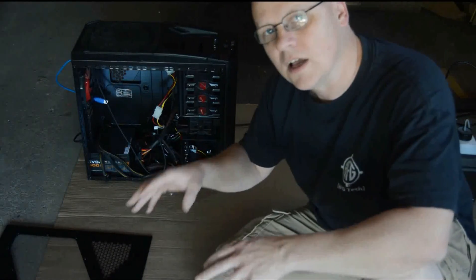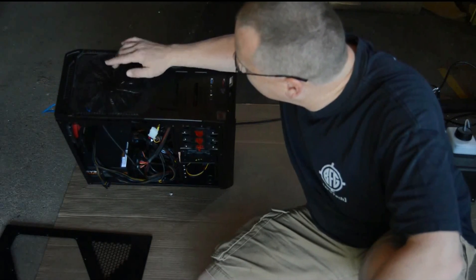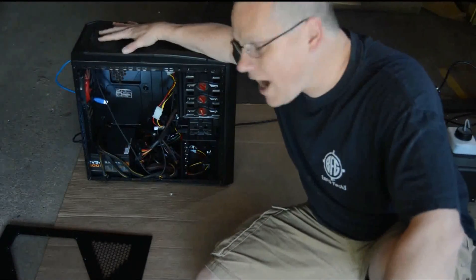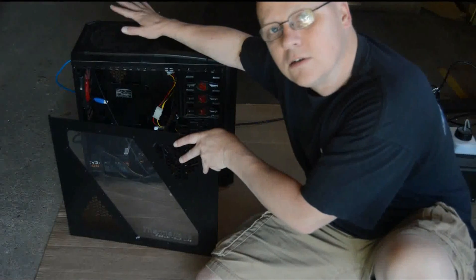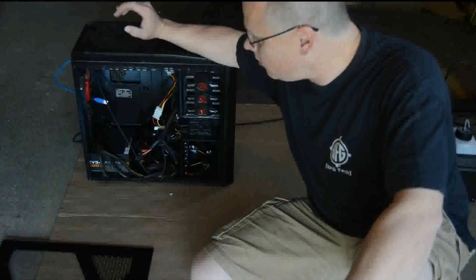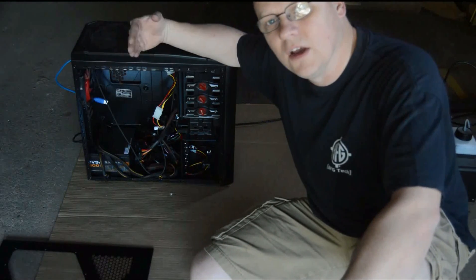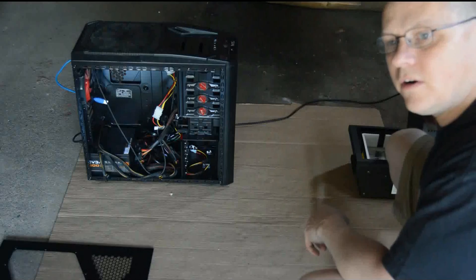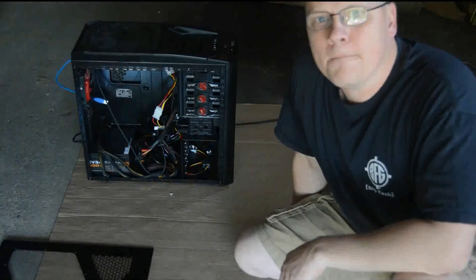All that nice cool air to cool the components. What I did last night is I took this case apart. Up top here is a fan, a rather large fan — it was sucking air out. What we want to do to get positive air flow is to get more air coming in than going out. This case has a lot of vents, so I decided to turn this around to get as much air flow in as possible. To demonstrate what kind of air flow we're getting, we're going to use this fog machine I have from one of the Halloween parties we had for our kids quite a while back. That should be rather useful here. Let's get to it.